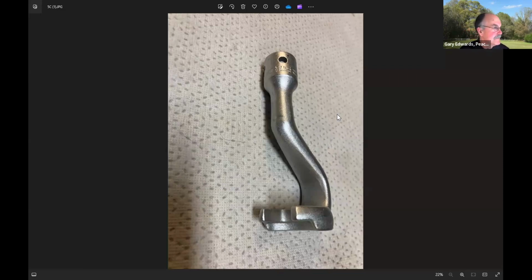No, he says it's got 272 miles, not 272,000 miles. Oh, okay. 272 miles. I would look very carefully to see if you have chain stretch, and I would change the guides and the cam oiler tubes, and your chain's probably going to be okay.